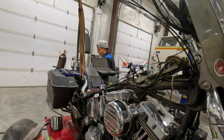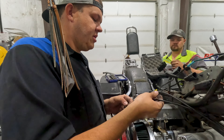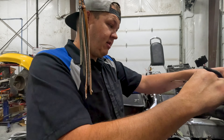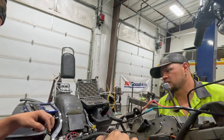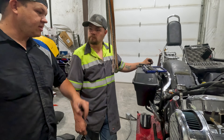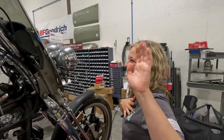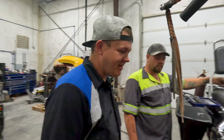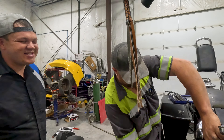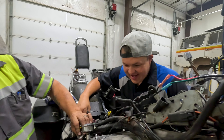I can't get that throttle pedal out. Sometimes you're the dog, sometimes you're the hydrant — or you're the grass below the hydrant. I have to conquer this. You finally got it — I am now the dog. Throttle cables expertly removed. There's two of them — in case you guys are curious. One pushes, one pulls. So if it's a little bit stuck you can force back. Do you know what else is smart to do? Check the level of your oil. It does help. You checked it once that said zero. Oh, poor Harley. Just accept defeat — oil leak. No, it has an internal oil consumption problem. It should go to AA for oil.